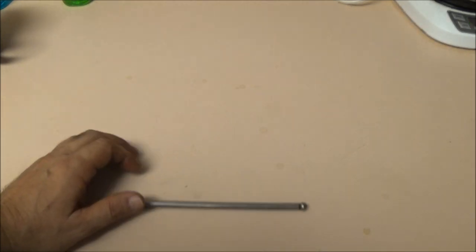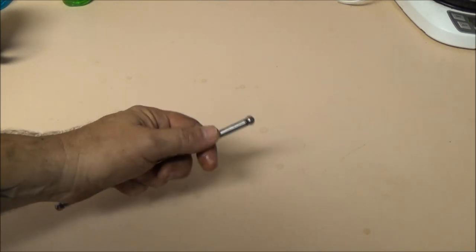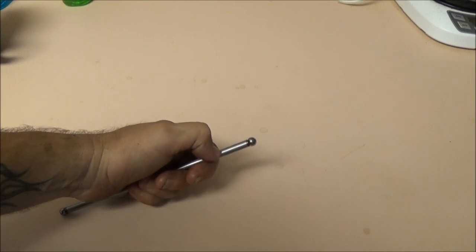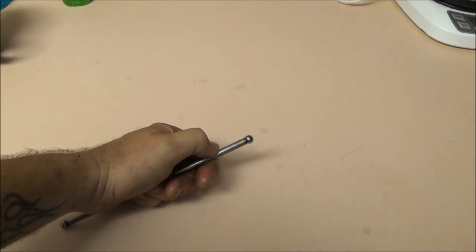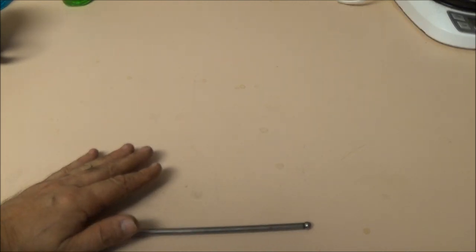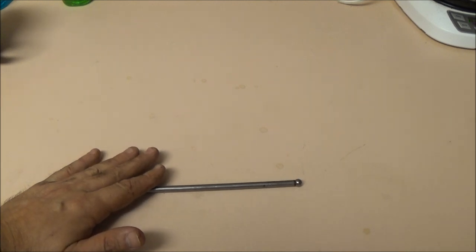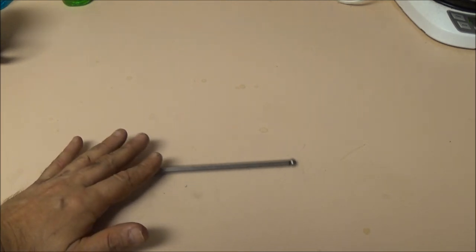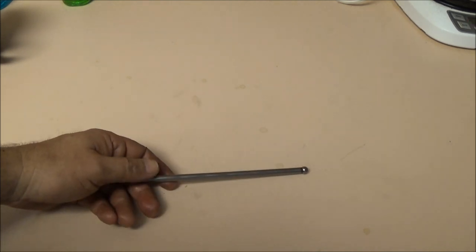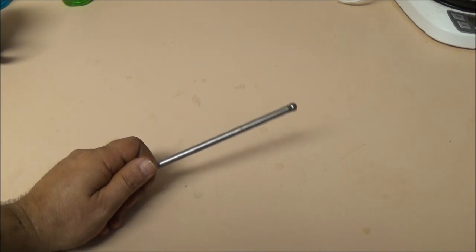Also found out there is no adjustment on these valves - they have hydraulic lifters. So it sounds to me like a valve is staying open too long. The only other thing that could cause that, other than being too tight on the adjustment, would be a burnt valve or a cracked valve. So we may have to tear into the head. Let's go get this put back together.